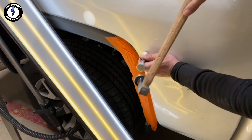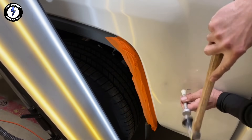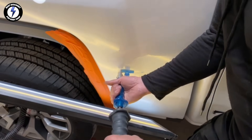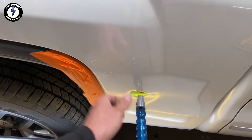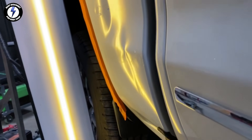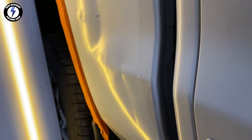Now it's time to use the knockdown in conjunction with my body hammer. I'm slicing the air artfully and skillfully with the hammer. Going back in with more glue tabs — gripping and ripping. Pulling back on the hammer on the slide and bang. You're getting a full free tutorial on this truck. It takes me a couple weeks to do an edit — please leave a comment down below and let me know if this is helping you on your bedside repair. Next, going below the body line.